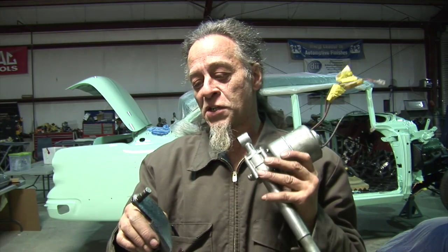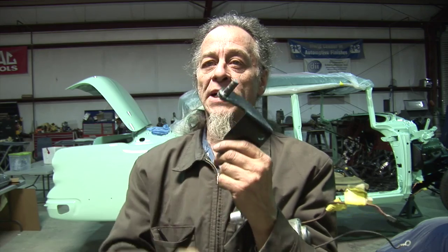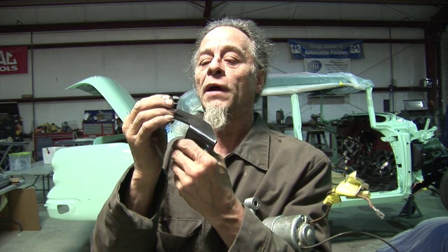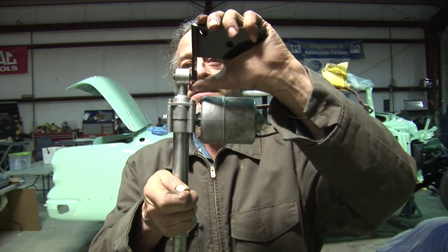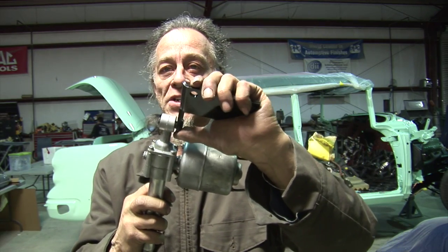When I did the seat motors not long ago, I noticed that one of the brackets on the horizontal adjustment motor didn't have an e-ring on it. There's a little groove where the e-ring holds the motor on. Come to find out, they messed it up from the factory — there's a piece of metal here that's preventing the e-ring from going on all the way. So now I've got to fix the factory's mess-up too, which is common for most cars.